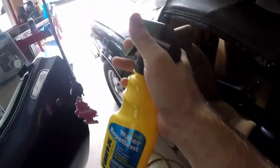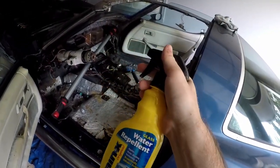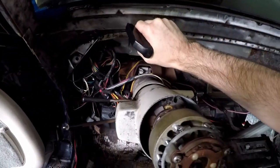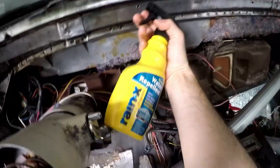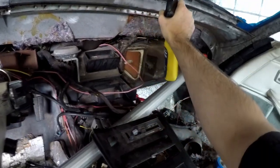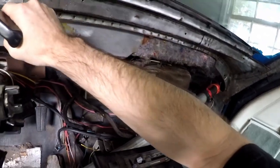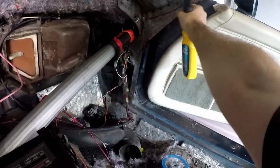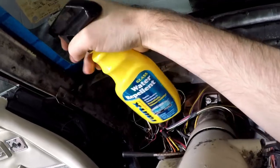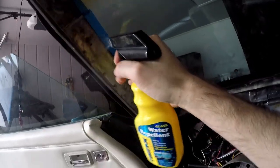My plan is to hit the harder-to-reach areas first — the inside of the dash, the underside, the bottom side — get as much of that done as possible. Might as well clean the whole windshield frame area while we're here. Diluting the cleaner degreaser at four parts water to one part cleaner in an empty spray bottle. Spraying these areas and keeping it wet for 10 to 15 minutes, then wiping it off with water. You can see the dirt coming off of it.